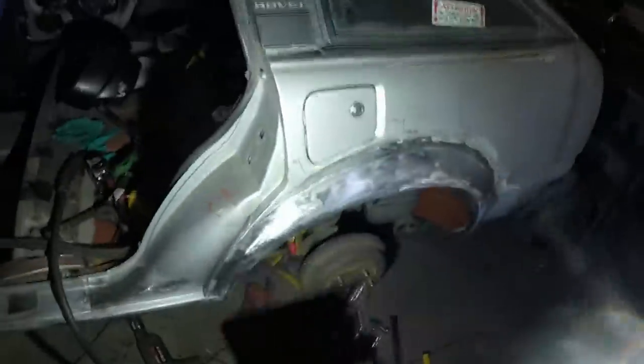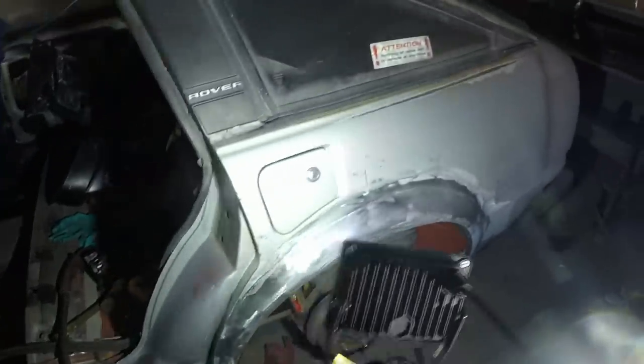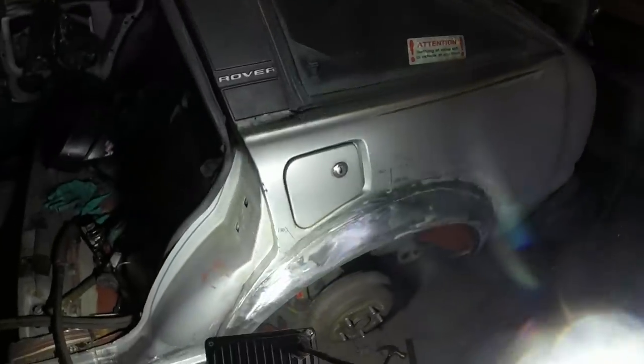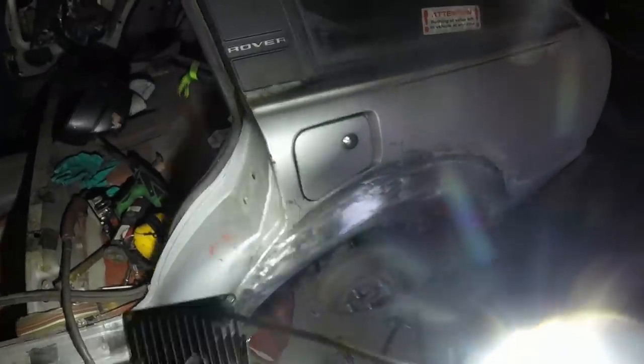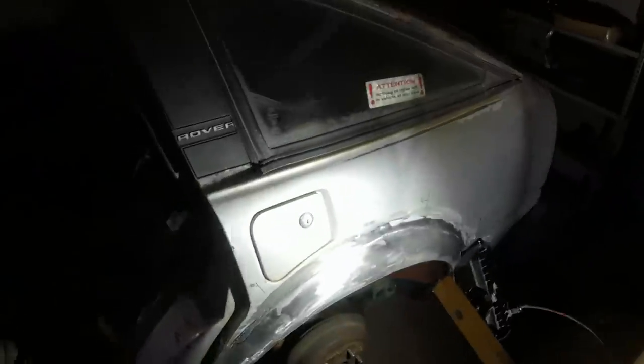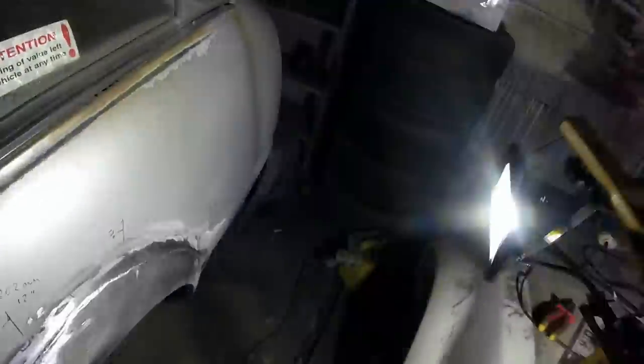So I've just cleaned that off with the strip and clean disc. I'll do the plug welding now, and then I'll wipe and sand down the whole area again, and then cover it in etch primer just to stop it from rusting. Oh, more welding. Might as well leave that off, since I'll be doing upside down welding now.